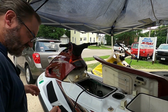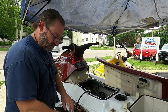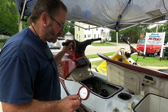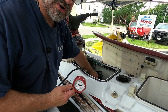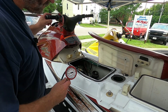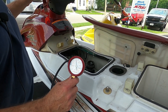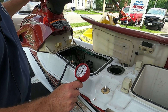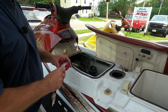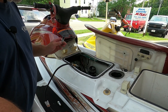When I'm working by myself, I've got a large rubber band and I put it on the grip and on the throttle to hold it wide open, keeping my hands free. But right now we're going to do it without moving the throttle — throttle plate closed, one spark plug out. I'm in cylinder number one, with cylinder number two in. I'm going to take the spark plug out and hopefully you can hear the difference in speed and how the motor turns. Fire in the hole — a Yamaha 700 single carb. We're at 150 pounds on my Snap-on gauge, which is perfect, right in spec, right where it should be. That is throttle plate closed, no spark plug.